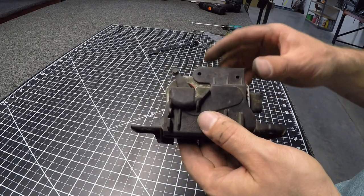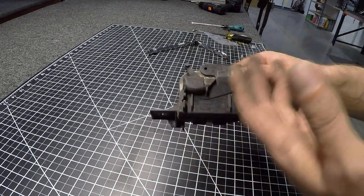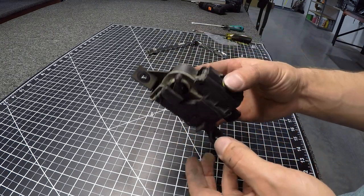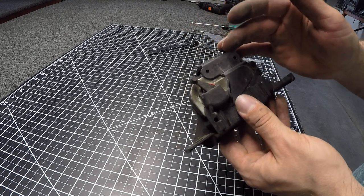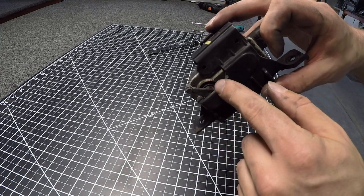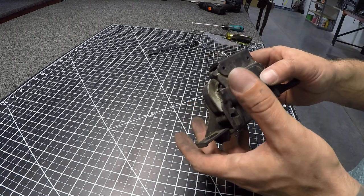So we've got the motor out of the active grille shutters. You're going to see this little arm — this arm moves back and forth to basically control the active grilles. When you first start the vehicle, it goes all the way through its full range of motion to check that there's nothing wrong with the system. Mine has over a hundred thousand miles on it so it's quite dirty — yours is probably going to be cleaner. What we're going to do is manipulate it so that it thinks there are still grilles connected and that there's proper range of motion. First, clean the surface off and mark the original position, because we're going to be re-clocking this gear. Use some sort of colored marker — I used red — and mark the original position.